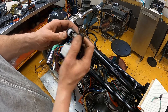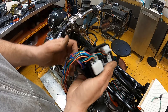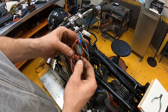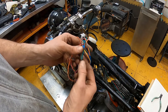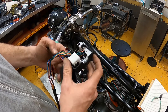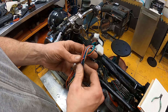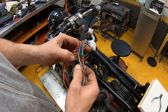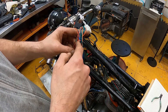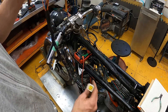The hazard light wires that I'm converting into the headlight on/off switch are integrated with the signal light wires in the harness. I'll separate that junction and run a new wire — a new color — through the loom to the plug so I can reassign that function cleanly.